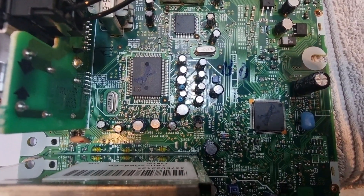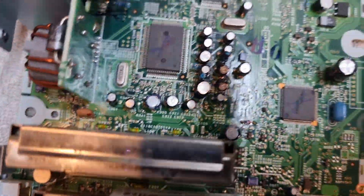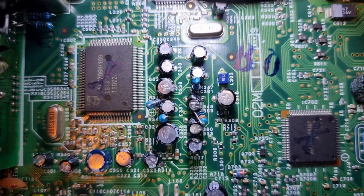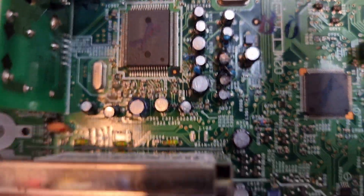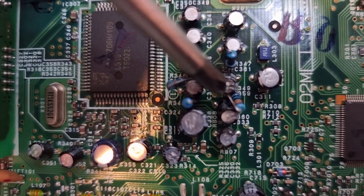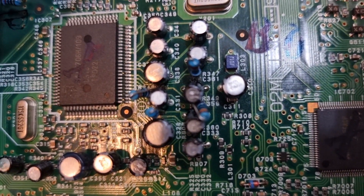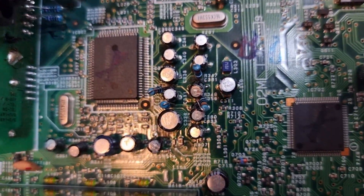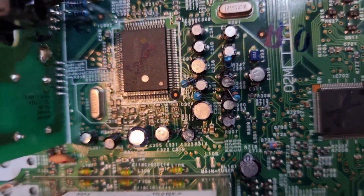Right, time to do the other side. I think we're done - that was very tricky. There's the other two. On this one I had to remove this capacitor to make it a bit easier. That's all done now. For the auxiliary mod - where I mentioned tying the auxiliary left and right to 10K to ground to remove some hiss - I've done that too.